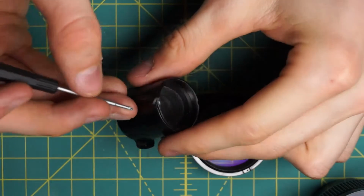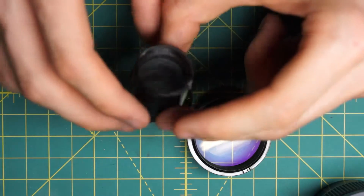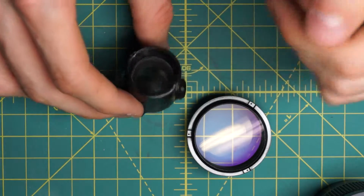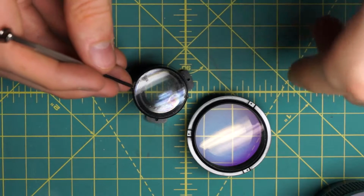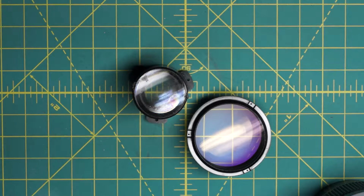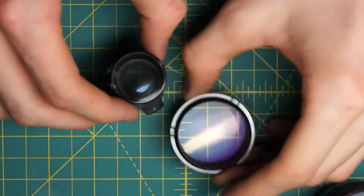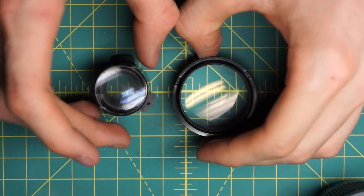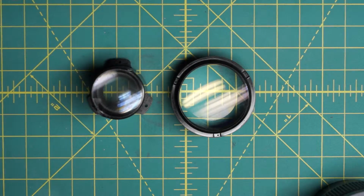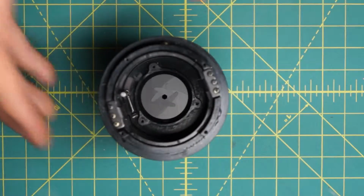So that's why I tried to go in from the side here and lift that off, but even breaking the lens in this way, I wasn't able to do it, and I was afraid that I was going to end up cracking the entire back element completely if I tried any more, because I was already fracturing little pieces off on this side. So I pretty much wrecked the lens trying to repair it, but it already had fungus inside, so it was not usable as it was. That's just a really annoying design decision, and it's the reason I don't consider this lens particularly repairable. You can repair other elements of this lens, but not the optics, like you can with a lot of the other Minolta lenses.